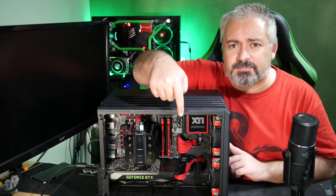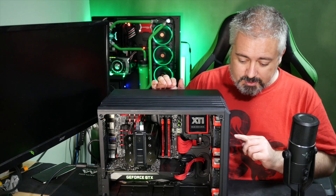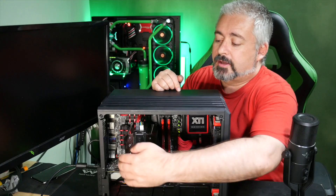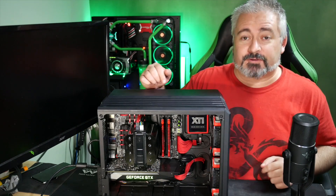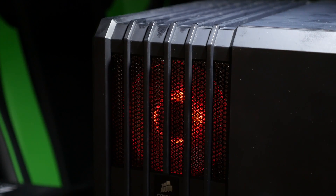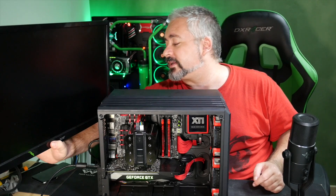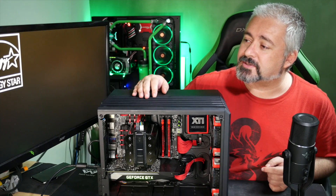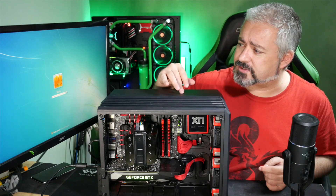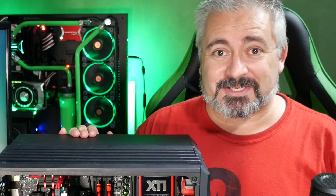Here's the moment of truth. I'm plugged in — as you can probably see, there should be a little green light on the motherboard telling me the power's on. Plugged into the monitor so we can see if we boot up. Good sounds! You can see the light on the cooler through the window, and I can feel airflow coming through it. The fans look awesome from the front of the case — I'll have to give you a cut-in video of that. They're running at a decent speed. There's a monitor issue — sometimes you have to unplug it and plug it in for it to be recognized. But we should be seeing some BIOS and Windows booting. The drive still has an active Windows installation — hooray! Windows 7 boots up. Success! That was amazing.